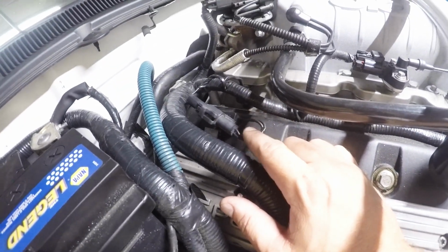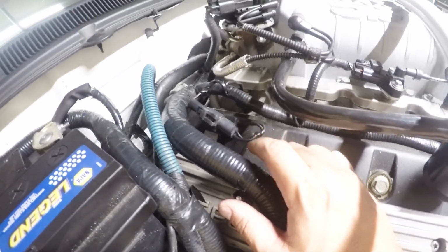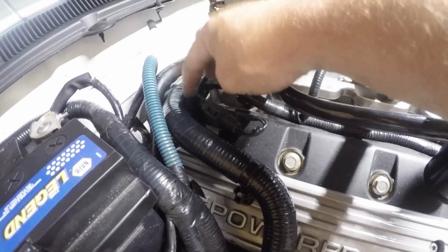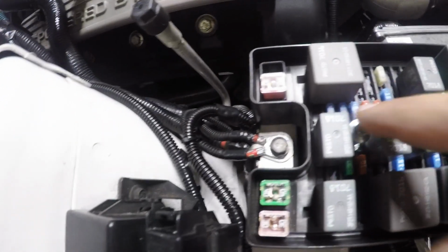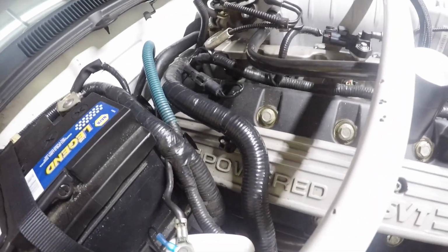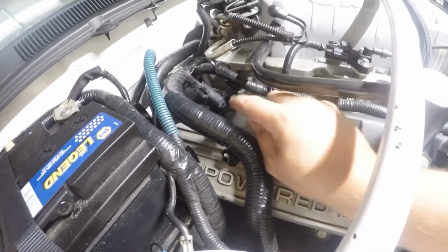This piece is what's called an ignition transformer capacitor. What this also runs in line with, because if you unplug this, car will not start, obviously. This runs in line with this cable that goes right to there, fuse number 40, which is ignition coil power wire. Right there was where I cut it out of the circuit.